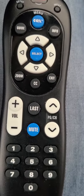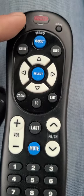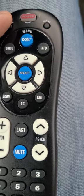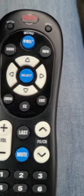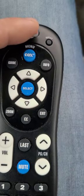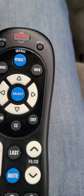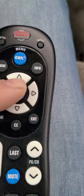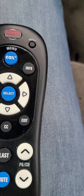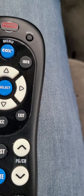Okay, let's go over this again. Turn on the TV. Press and hold setup — that's that one — hold it in until the power light flashes twice, then release it. Then quick-press the power button just one time. After you do that, press and hold the select button, which is right there, and hold it in until the TV turns off. Then release it and it should be programmed to your TV.